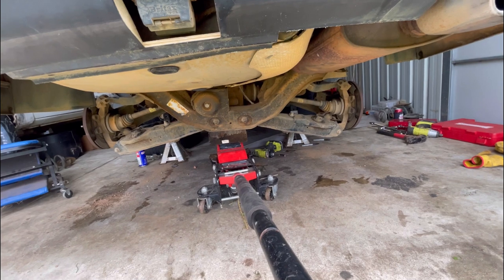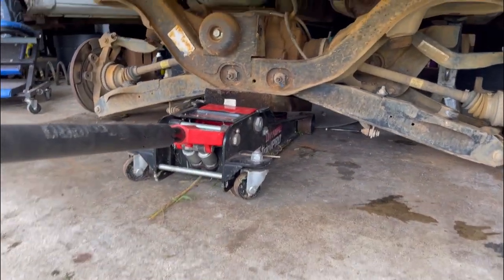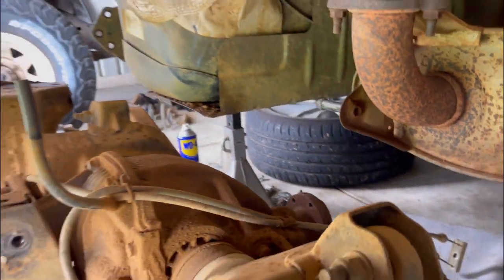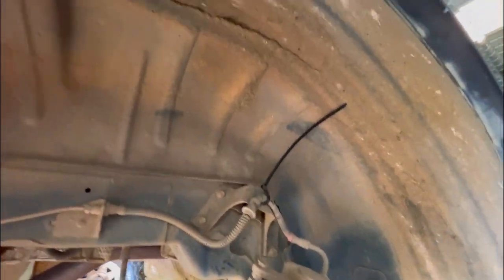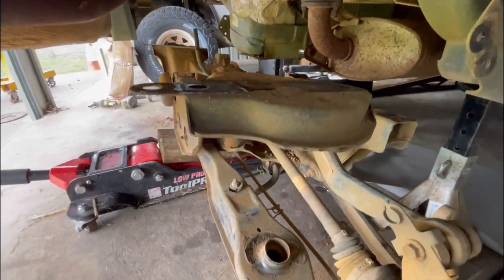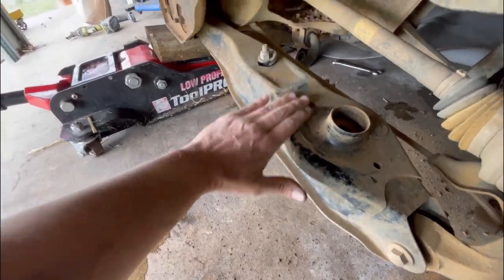I've put a big piece of wood under the whole thing to balance it because it would have just fallen backwards otherwise. And there it is — all lowered down, came down easily. I did forget to take the hanger off the exhaust but there was no weight on it so I'll just pop that off easily. I can drag that out now and do what I need to do, but I'm not going to drag it outside because it's going to be in the rain, so I'll leave it in here overnight. I am going to clean up all of these wheel arches a little bit, clean up the threads, and probably just spray it with some WD-40 — it's just dust so it'll come up pretty good.